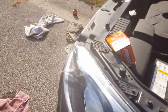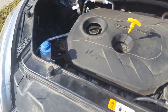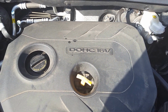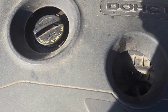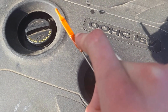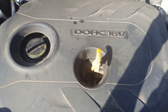One on, one off. And I'll let it wait for a little bit. But after you shut it off, check your oil level. Make sure it's at the right level. I know it's going to say probably full because I haven't cleaned it off. Yeah, it shows a little bit more than full, but this little second stub here of the full, I like to have my oil right there so I know it's full. So let me go ahead and clean it off and check it. Make sure it's at the right level.